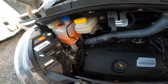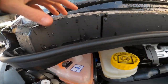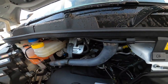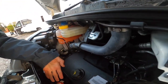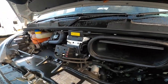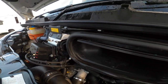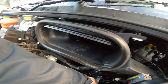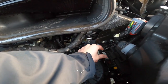You've got your various fluids here. The screen washer in the corner is the main one you'll need. Remove these clips and this panel lifts off to fill your power steering fluid and radiator fluid, and you also have your brake fluid there. You've got your oil filler and dipstick. If you need to jump-start the vehicle — give or receive a jump — put the black earth clip on here, put your key in and lift up, then put your red positive onto this contact here.